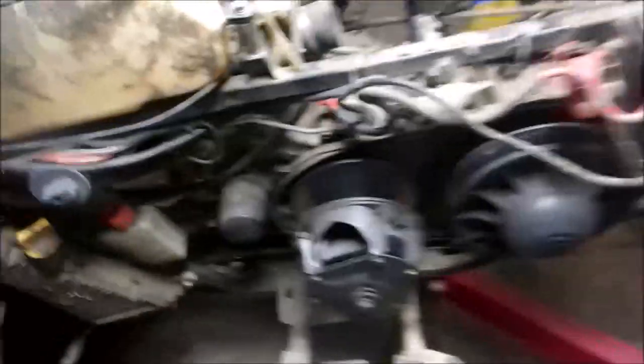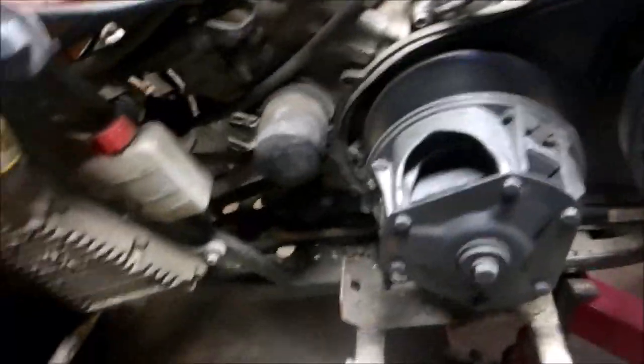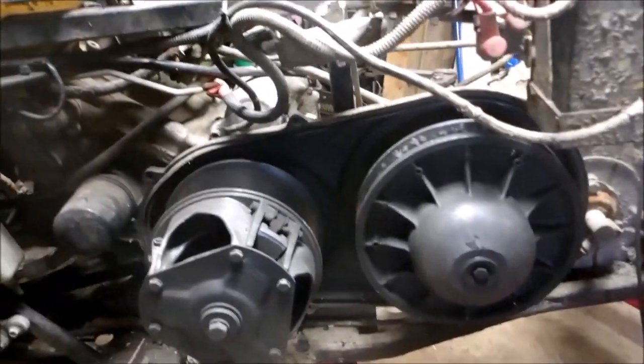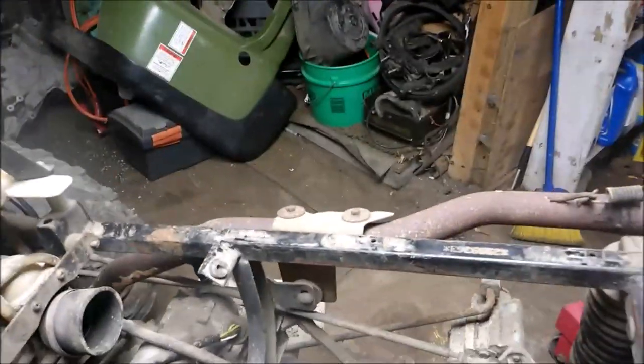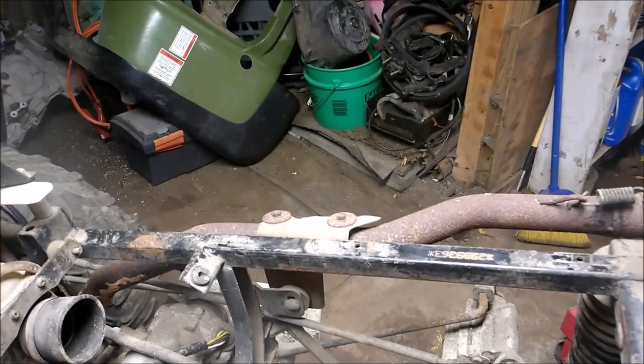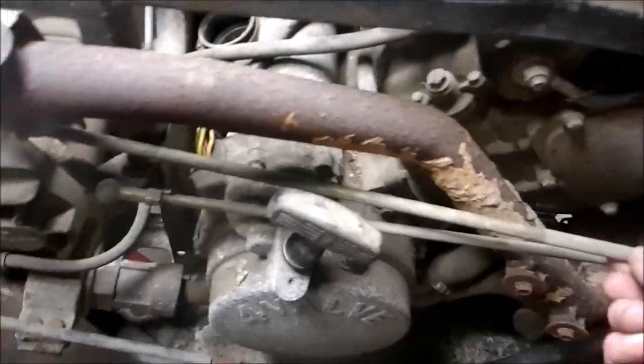But there's a bonus — there's a nice newer clutch on there that's not a Polaris. Initially I first thought it might have just been the shift linkage that was maybe bent or not adjusted right. I've actually bought a couple ATVs where the guys thought the transmission was shot, and all I did was adjust the shift linkage.